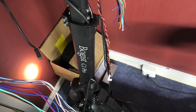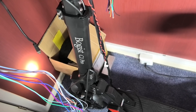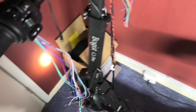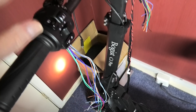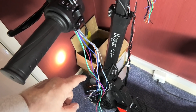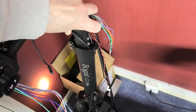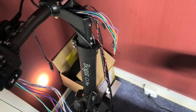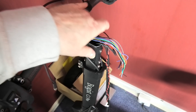The light comes on — that's going to be the DRL, the daylight running light, purely so I know the BMS is powered up. If I put it on a light switch and the light switch is off, I still won't know if the BMS is on. So that DRL is going to be on permanently. You hold the button for five seconds, it will beep — it doesn't at the minute — and then it should go off. So I've got all this rats-nest wiring still to sort.